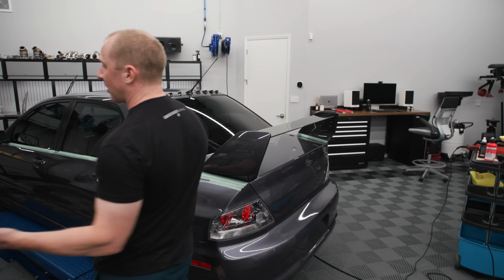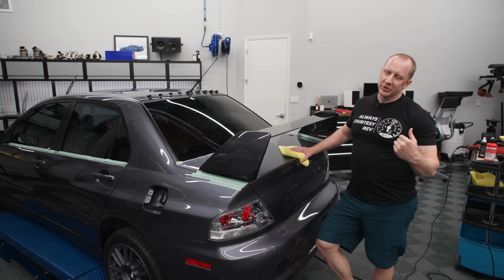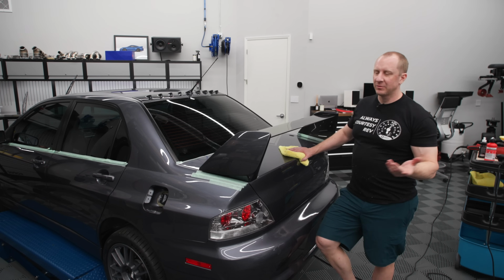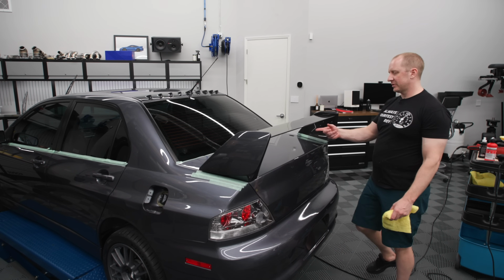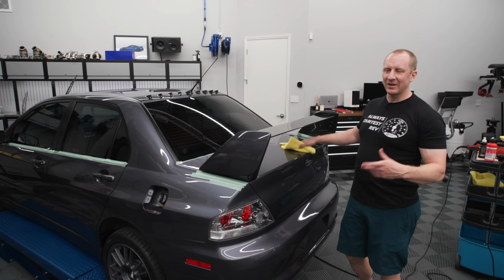Now, in this case, on this car, in this paint, I knew that 4 sets of passes, I don't even need to micromanage it. And so that's what's going to happen to you as well. If you use this stuff, these polishers, these pads, the polishes, have some CarPro Eraser when you're done. I'm going to spray some Eraser on here and wipe the polish residue off before I do any waxing and coating.